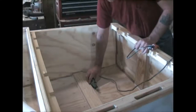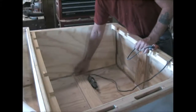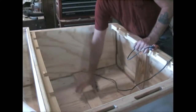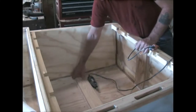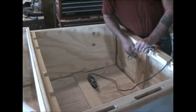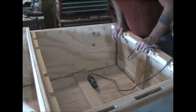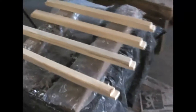I'm just about ready to lay some glass and resin. I'm going to do this the same way I did the forward compartment — put a piece of six ounce cloth down on the bottom. I'm going to be throwing stuff in here, so it needs to protect the wood and seal it. It will come up on the edges a little bit, and the sides I'm just going to wrap and soak. Then a coat of primer and I'll be ready to paint this too. These are the deck supports for that back deck.